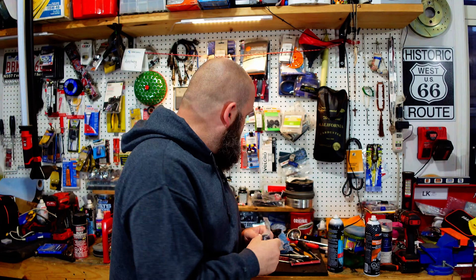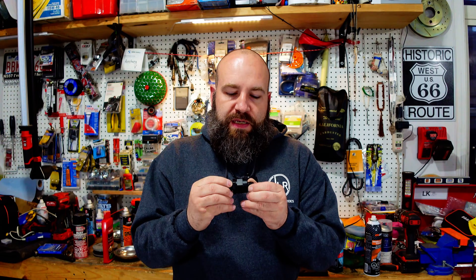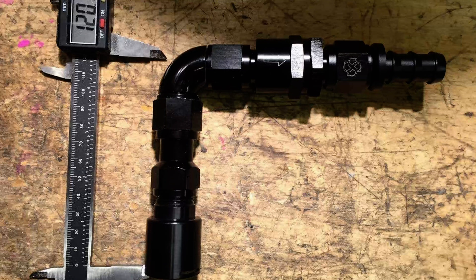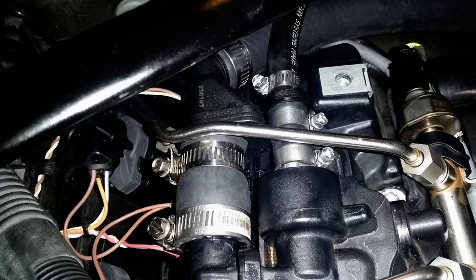Once you put that in, that's going to be a very tight sealing fit. Past that, you're going to want to put a little bit of hose to what they call a china valve — simply just a one-way check valve. The reason you'd want to use one of these is because it doesn't actually bleed back on vacuum. You're going to have the arrow, so that will go towards the rear inlet. Realistically, you could put hose just over top the end of the AN fittings and hose clamp it down, and it's going to work the same. Your goal is to go from the delete fitting, put the china valve in, and from the china valve adapt it to the factory heater. Sometimes you can keep the factory flapper valve and upgrade it to an OEM or fresh unit, and you should be fine. I'll include a picture of how I made mine leak-proof.